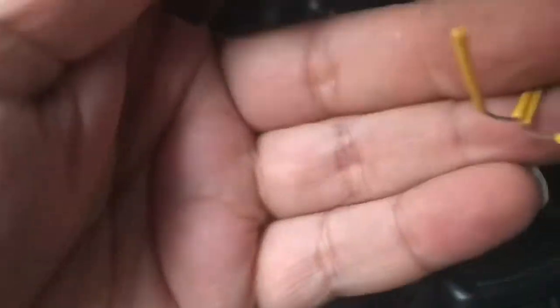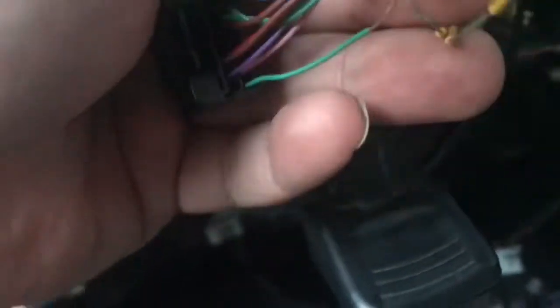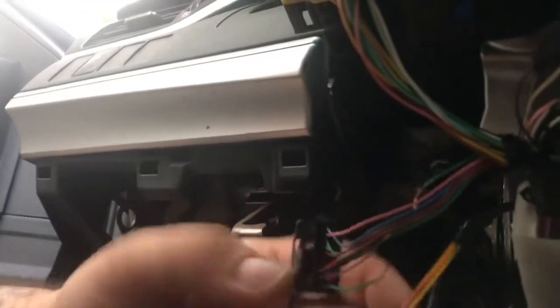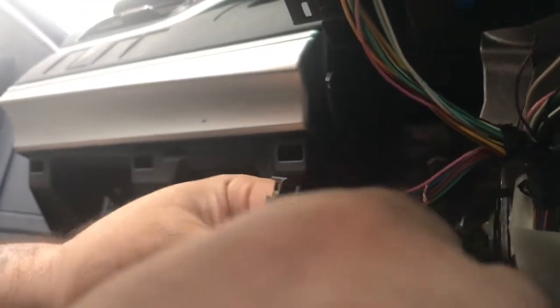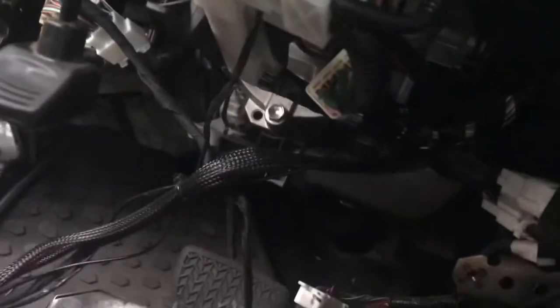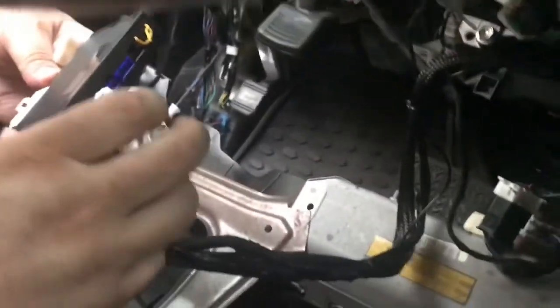Take your cutters and split this wire. Once this wire is split, from the plug side, you want to connect yellow with the orange stripe to the plug side with the provided connectors. Okay, now we just finished soldering our wires and we're going to plug the plug back into the car. Once plugged in, we're pretty much ready for programming.